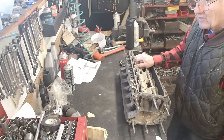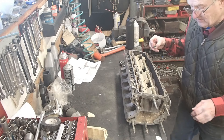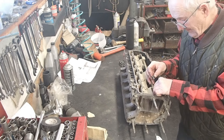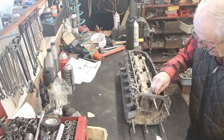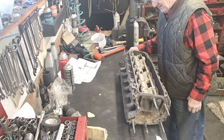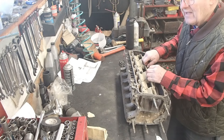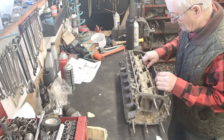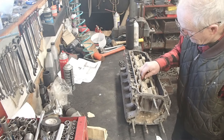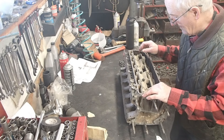This is a very critical manifold — it's not visible. The way you can tell if it's leaking is if you've got water in the carburetor, or water in your gas, and you might think that's the problem when in fact it's this thing leaking. So it's a good idea to make sure you've got a good cover. I have never had any luck surfacing them on a surfacing plate and having them work — I tried it two or three times back in the old days and I wasn't very happy with the results.